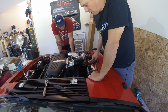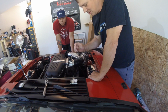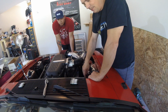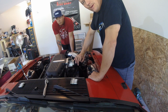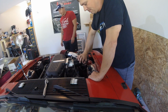However, we are going to force the fuel pump on, and then we're going to give some air pressure to this line, about 8 or 10 psi, and see if the fuel pressure climbs. If it doesn't, we know that it's probably something with the fuel pressure regulator. So we're going to get into the ECU, force the output for the fuel pump on, and then give some air pressure to this line and see what the gauge does inside the car.